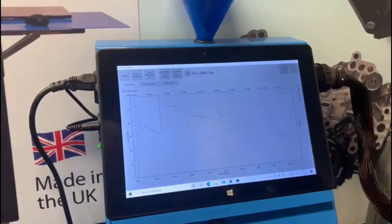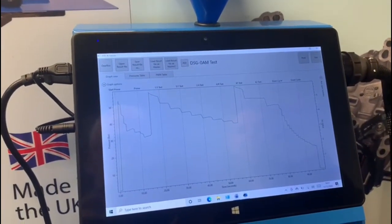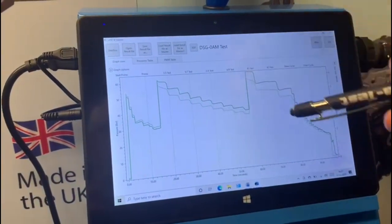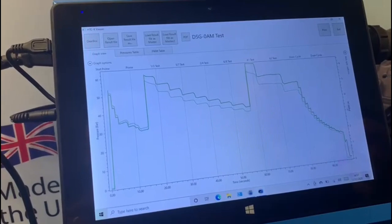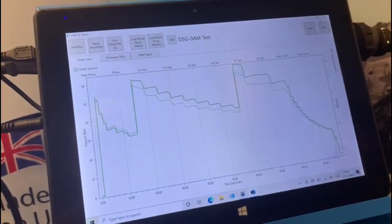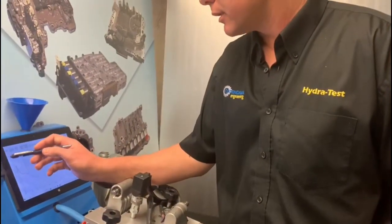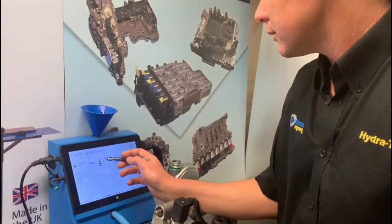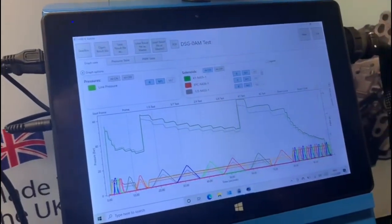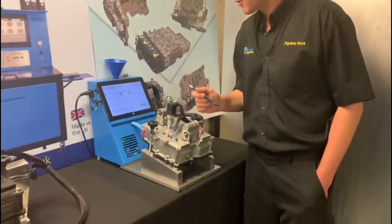You will note that the green line is output pressure — or line pressure in this case. I've put a little bit more pressure into the unit compared to when the data was collected, but you can see the step-down working its way down the graph, telling you that those actuators are all responding in time as they should. I will also load the solenoid data onto your screen — you can see we are trying to follow the data as closely as possible. And that's a complete test performed on this stand, completed in minutes.